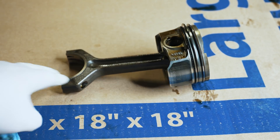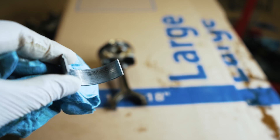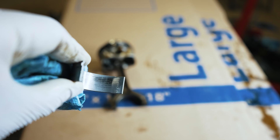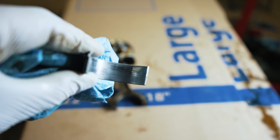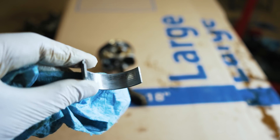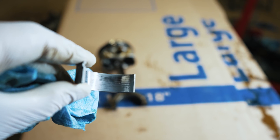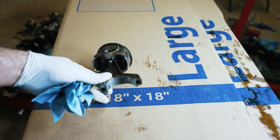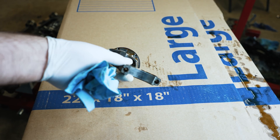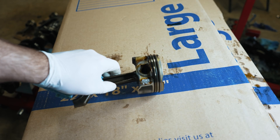I want to know what you guys think of those connecting rods. I think the cause of the failure was just these bearings — the clearances for whatever reason didn't work out. Here's one of the bearings that didn't spin, but either way it was beat up. Clearances were too tight or something was off with these King bearings. Everything was fine on my motor up to 200,000 miles, but when I put these in I got the failure shortly thereafter. There had to be something to do with clearancing, something that doesn't add up. So I'm just going to chalk it up to upgrading to these bearings causing this issue. If I'm going to do this again, I'll go with a different brand or maybe even stick to OEM bearings. I thought it would be interesting for you guys to see the inside of your N54 or your BMW engine to see what they look like and how they're built. That'll conclude this video. In the next video, I'm going to get my car tested on the dyno to see how much power it's actually making now with the new engine. If this is the first video you're catching of mine, please consider subscribing — I do upload regularly. Thanks for watching.